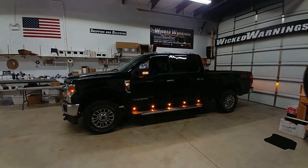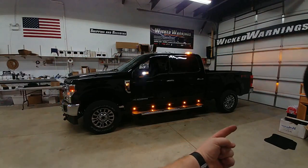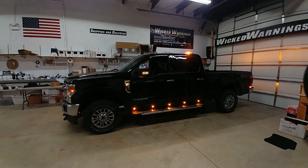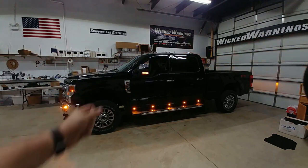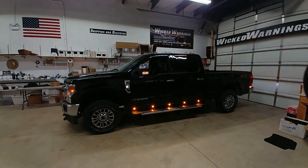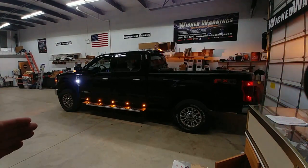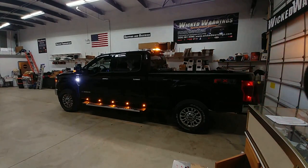Here you can see the alternation on the side of the truck. We have the LED HAW DUO in the fog light synchronized to alternate with the TIR-3 on the back bumper, so we get a clear picture of exactly where the front and back of this vehicle is when you're a couple thousand feet away at night looking at it sideways. We also have our Thin-X LIN series in amber white right here in the badge — a very popular spot. The Thin-X badge light comes off the truck at about a 45 degree angle and really covers the whole rear area quite well, with a nice alternating color change flash.